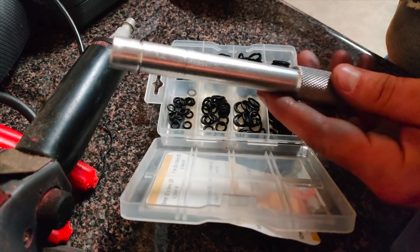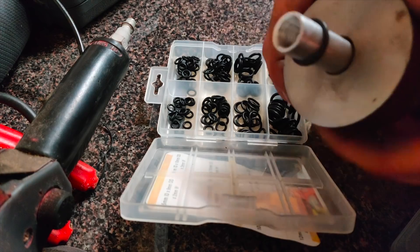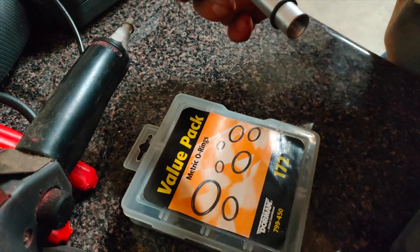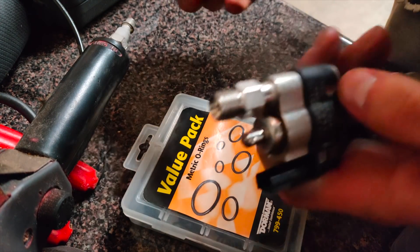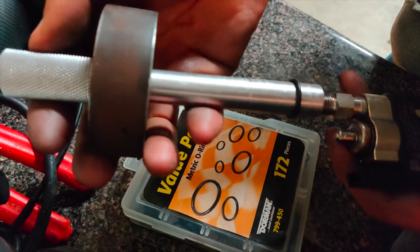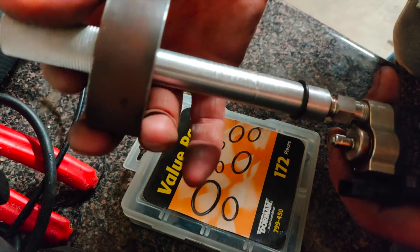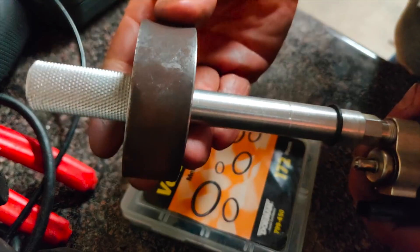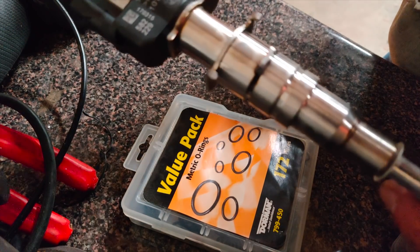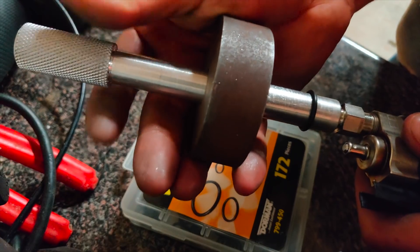Now to assemble this, I just have to put the weight on the shaft, slide the o-ring into the groove which will hold the weight in place. Using one of the new injectors as an example — this will simply tighten onto the top of the injector like so. Then maybe a good hit or two and the injector should pop right out without having to wiggle it and risk damaging either the old injector or more importantly the port and the head.